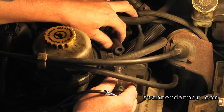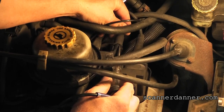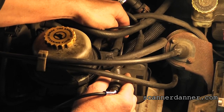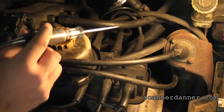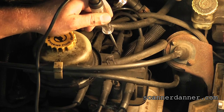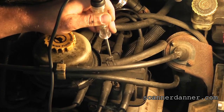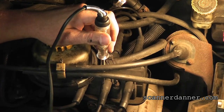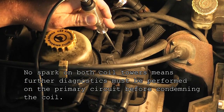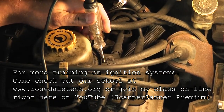That got me a little bit because I put my finger closer than the light. I don't recommend this procedure if you have a pacemaker. The middle coil has spark on one half and not on the other — that's my number four miss confirmed. When we have no spark on one side of a coil, you have to consider the primary. If there was no primary activity, we'd have no spark on the companion side either. So we're done — this needs an ignition coil.